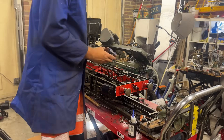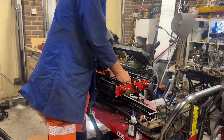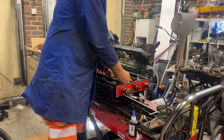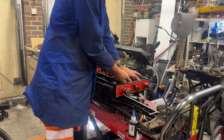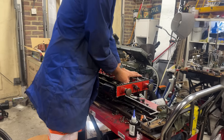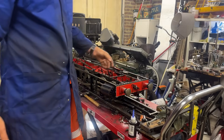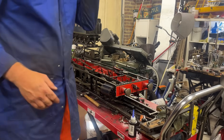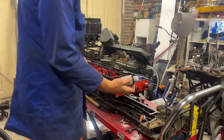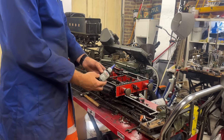We don't want masses of excess — it's only quite a thin bead. It spreads out quite well, this stuff, so it's not actually that much. We'll get that on the engine, then it's just a case of refitting all the nuts and then it's all done. I'll give a word about this stuff — it's the Liqui Moly gasket maker.